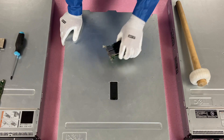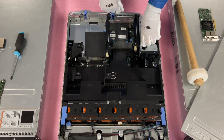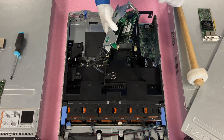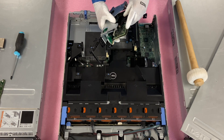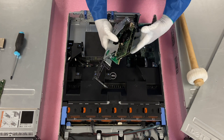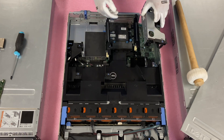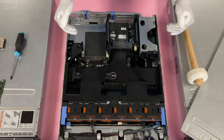So now we're going to install the PCIe version of our NIC card. We need to just pop the latch and open the top. We're going to come back here to riser one and lift this up. You see these two blue buttons — you're going to push the first one and lift this black latch up, then push the second one and remove the black latch. Then you're going to come in and make sure you line everything up properly, because this is a bit of a tight squeeze when you have PCIe cards right on top of each other. Just line everything up properly and make sure you have a nice solid connection. Everything's in perfectly, so we're going to put our latches back on to keep everything firmly secured into the riser, and we're just going to drop the riser back in. Really, that was nice and easy overall — the riser's nice and flush and we've installed both our NIC cards.